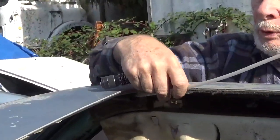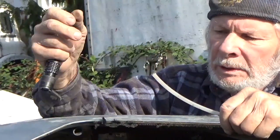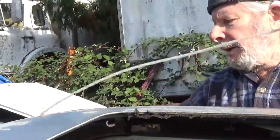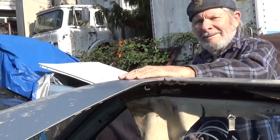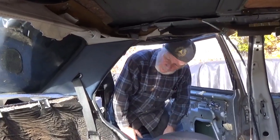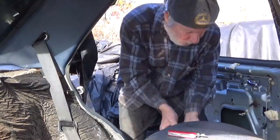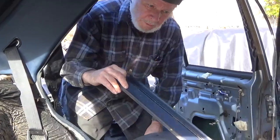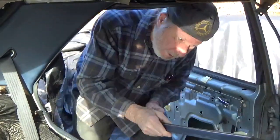And occasionally you want to pull it out, and there'll be stuff plugged around this. You want to clean that off, and then do it again and again, and you can do your front drains. Okay, your rear drains, I've discovered, are not accessible from the trunk. The only way you're going to be able to do the rear drains without damaging your headliner, you first just rip off these rear sill covers. They just pull off, and you just pound them on real easy.